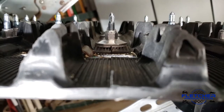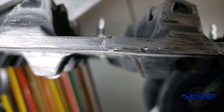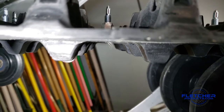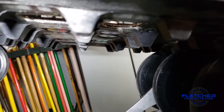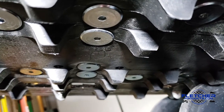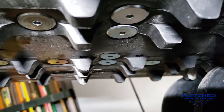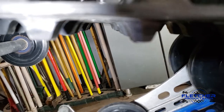Here's a good side-angle shot of the studs and backers through the track. This is a 136-inch track with an inch-and-a-quarter lug height — the W84 Warthog stud from Snow Studs with the aluminum backers, both doubles and singles. The pattern on this is two doubles and then two singles alternating throughout the track, varying the location so you have a good solid surface to pick into.